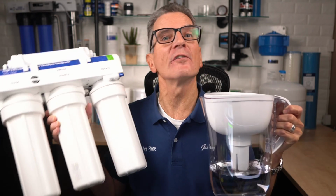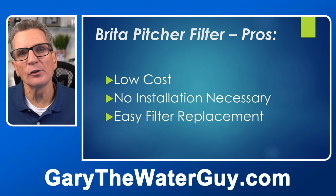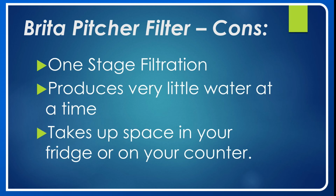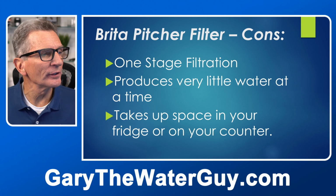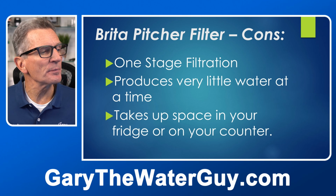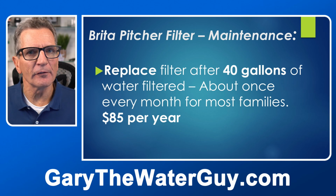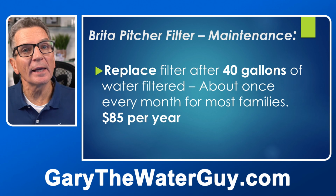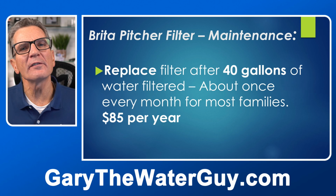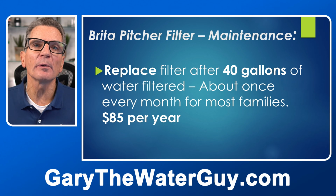So what are the pros and cons of each system? So when we look at the pros of the Brita, we can see that it's low cost, there's no installation necessary, and the filter replacement is super easy. And the cons consist of, well, it's just one-stage filtration. That carbon filter produces very little water at a time, and it takes up space in your fridge or on your counter. And in terms of maintenance, both of these systems need to have their filters replaced. So the Brita system, again, just has one filter, but the filter's only good for 40 gallons of water, about once every month for most families, which works out to about $85 a year in replacement filter costs.